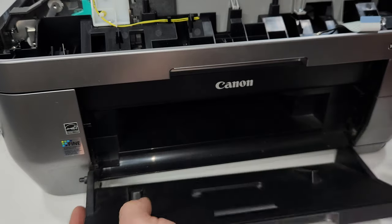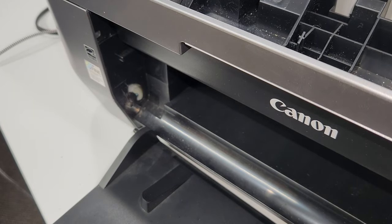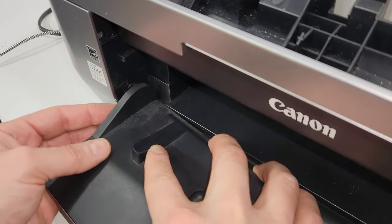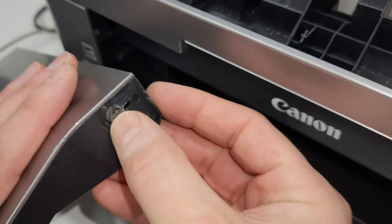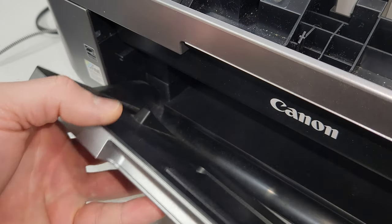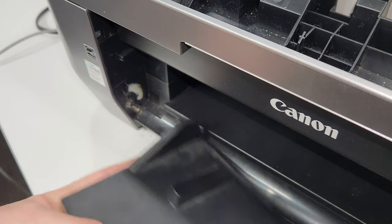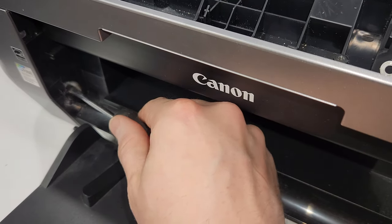There we go, so that's out. When you put the tray back, you have to make sure that you install it into the correct area. There's a spring in here. When you're loading it, make sure it's open because this portion is what it swivels on, and this is the guide for the spring. So when you close and open the tray it's soft. If you miss that, you're going to have a problem having the tray open properly. Make sure of that — the spring is in here. It's this white piece.